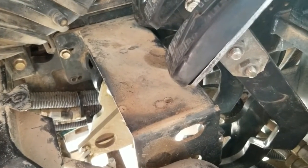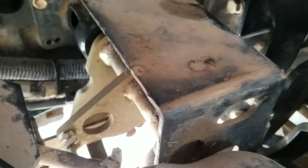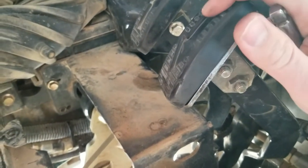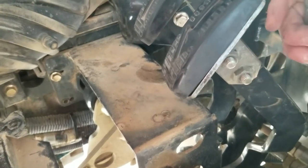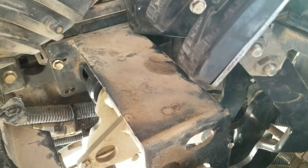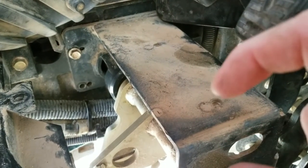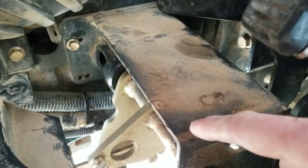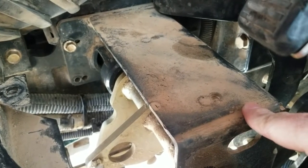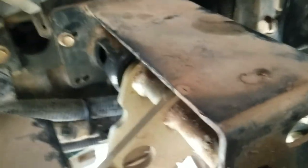I want to see if I need to shim that a little bit, take some slack out of it — maybe that's what's causing this. All the linkage seems to be working fine. The creeping starts with the most minuscule motion; you have to tap the opposite pedal to stop it. The linkage is returning to neutral fine. Another thing I noticed: if you come off the pedal fast and jerk the tractor, it generally won't creep — or it'll stop and then slowly start creeping again.